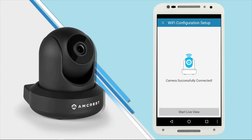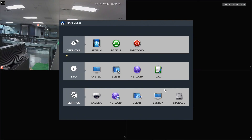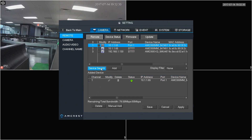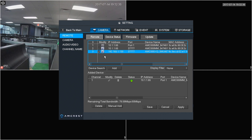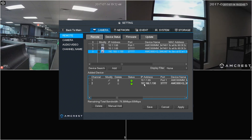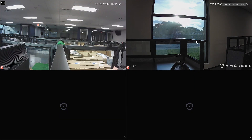Once you have logged in to your camera using the mobile app setup, go to your NVR's main menu and click on Camera. Then select Device Search to locate your camera wirelessly. Under Device Name, your camera's serial number should be displayed. Select it from the list by clicking the checkbox next to it, then click Add. It should display below once added, and the camera's live feed should come online within a few seconds. Click Save to complete the WiFi configuration. You will have complete functionality as you do with the wired setup.